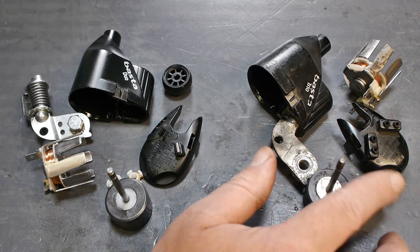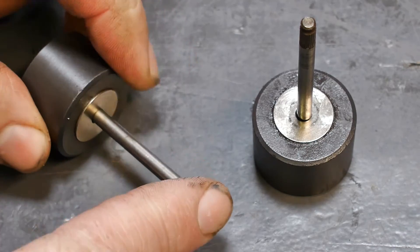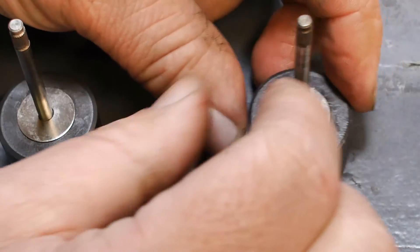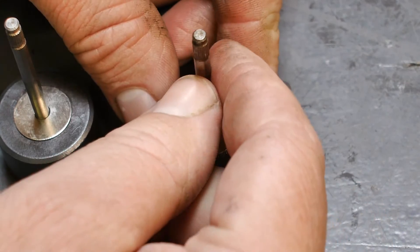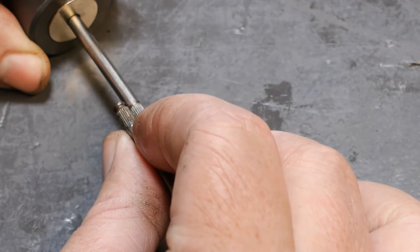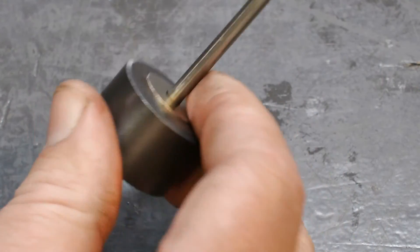Well, that's no longer possible because I no longer have a good drive wheel - but I assume that is still a replaceable part. Here are both of the permanent magnets and also the axles. This is the one from the Duo - it's the one with the C-clip plastic bearing, but it still feels better than the one from the Trio. There actually is a bit of scoring near the top here, probably from the metal bearing on the top that didn't get enough lubrication. There's also a small difference in the length of the splines - the Trio splines are just a bit longer.